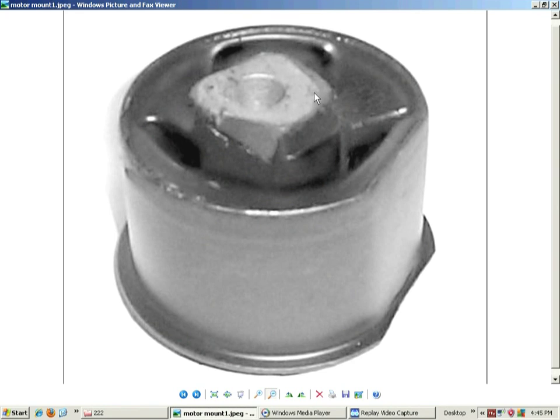I don't know why. I think I know why they make them that way, because it's a consumer perception. When the car is new and being rated by these consumer groups and people out there doing reviews, they say, well, the engine is smoother, so that's why they make these such soft rubber. But I can't tell the difference. But now when they're filled up with windshield urethane sealant, this thing will not break.